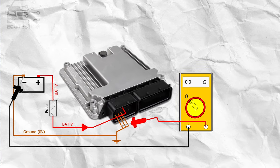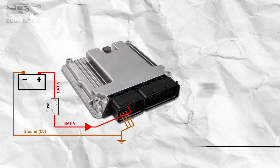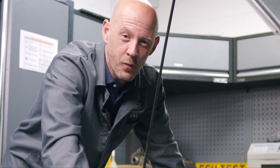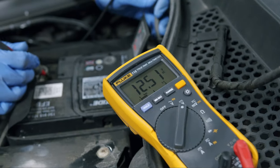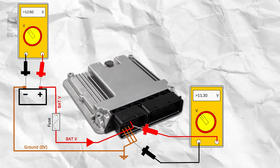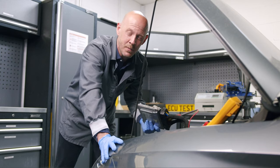If the wire is reading open circuit or has a very high resistance, this is an indication you have a wiring fault. However, this is not always the best way to test for wiring issues. A better way is to carry out a voltage drop test. For example, the battery voltage is 12.6 volts but the voltage at the ECU pin has been measured to be 11.3 volts — this would indicate a potential fault with the wiring. This should then be further investigated, and also check the grounding points on the vehicle.